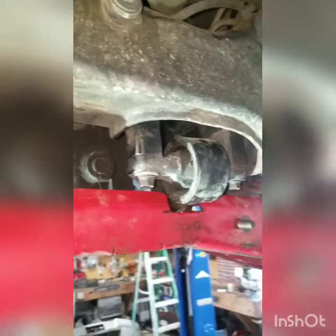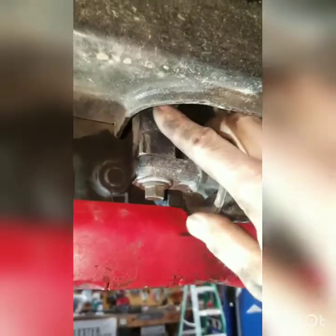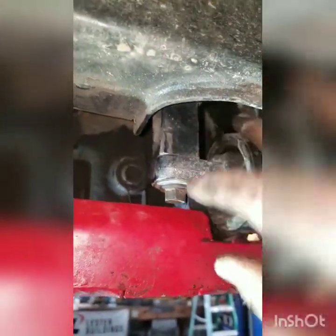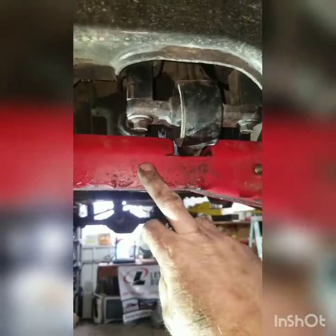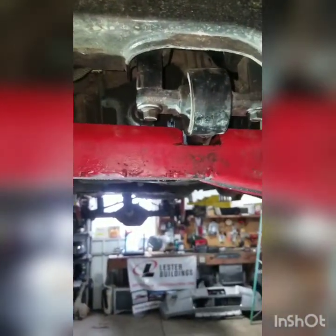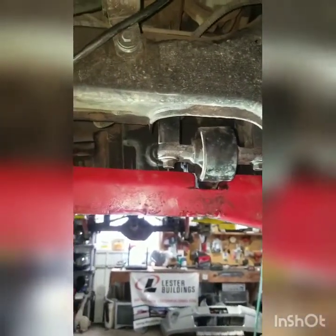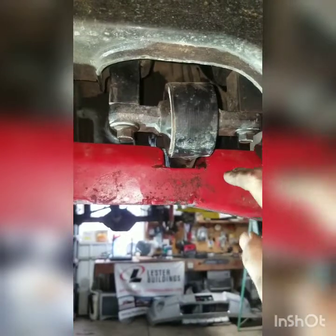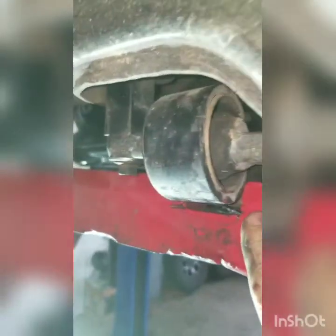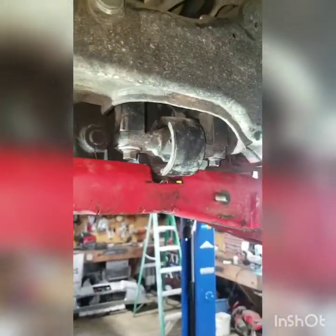I had a similar lift, but people were wanting to buy it. The way I had it made before was welded — I didn't feel it was good enough to put on the market, so we designed these other drops. On your front, you're going to drop it down — you're going to put these inch and three-quarter spacers with the bolts that drops your front down inch and three-quarter. I am running a Superlift crossmember with the drops and Superlift steering knuckles with my inch and three-quarter, but I bought those separately from Superlift after this drop. So all I did was a small notch in the Superlift crossmember, and I reinforced and plated that with steel after the notch to clear mine. That is pretty much all there is to it, guys.